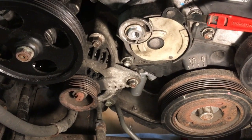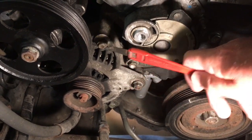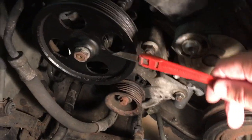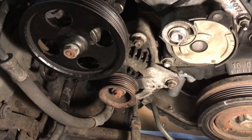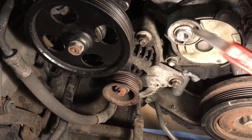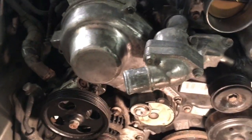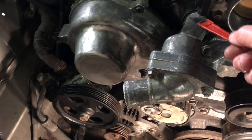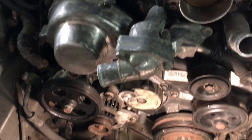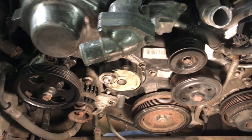Just keep going really. Serpentine belt tensioner in first, alternator back up, 3 bolts, or actually 1 nut, 2 bolts. Pulley back onto the power steering pump, just put a bar in there to tighten the nut up, and then a small cover here, 2 bolts, and then the camshaft cover on there, which is just a few bolts, with the thermostat housing back on, pipe, just a rubber seal in there. Make sure that you put a bit of grease around the seal to help ease it in, and that's it really on that side of things. Nothing really complicated there to do.